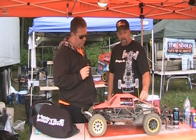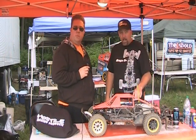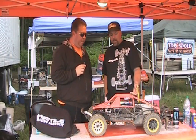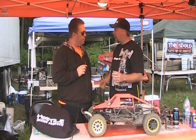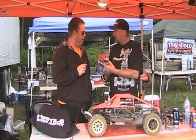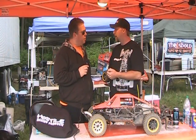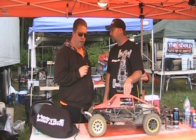After the first tank, retighten your spark plug and recheck stuff. A good thing to do is also check your pinion bolt. Yeah, that's a problem I have a lot of times. The pinion's always coming apart and blowing out the spur gear. I'll give you a team secret. When I take it apart, I run the bolt in from the back side. I red Loctite it from the back side, and instead of putting one nut on it, I double nut it. Since I've done that, I haven't had one issue of a pinion coming off.